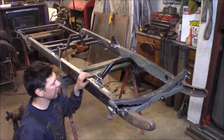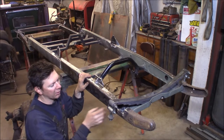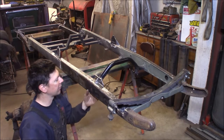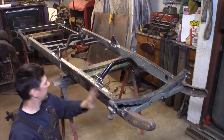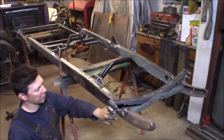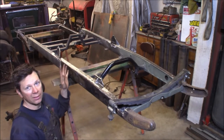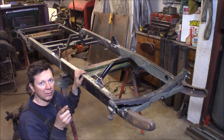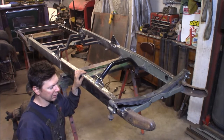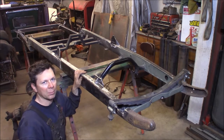The front end's all buttoned up. The only thing left is to flip the frame over — I've got to weld up a couple of spots on the top I couldn't get from the bottom. I've already got all the rust ground off the front original frame rails. I'm going to DA the rest of the frame, get everything roughed up, then bust out some Eastwood rust encapsulator and Eastwood chassis black, and paint the whole thing satin black.